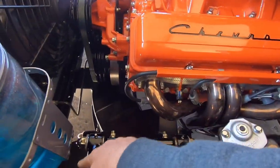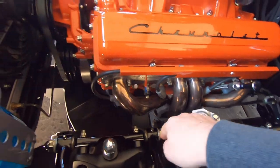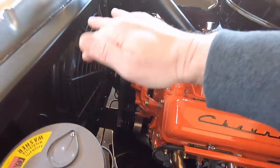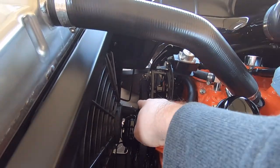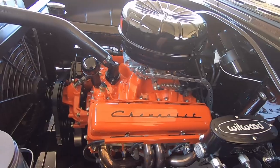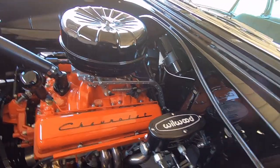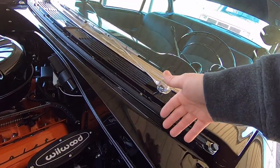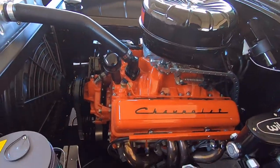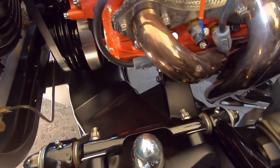The chassis got completely smoothed — there are no visible weld seams, everything is completely molded in. I plated in the top of the chassis, the rear, and the sides of the frame horns. This is an open channel, but I wanted the top of the frame really smooth, so I sheet-metaled it all the way down to about midway on the top of the floorboard under there.